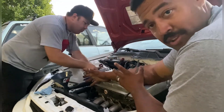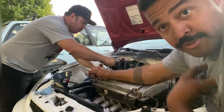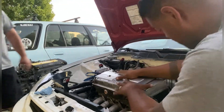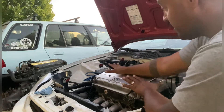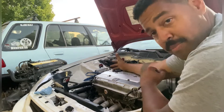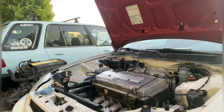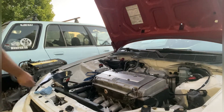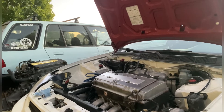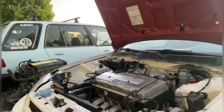I'm also very fortunate that when I went to prime the fuel system, my kill switch is a fuel cutoff switch — so when I flip that into the on position, my fuel pump starts on its own, separately from everything else. One of the things we didn't do was set the distributor. The timing should be good because it was good when it was taken out, so we just gotta set it here since this distributor came off the other motor. I'm gonna hop in there and try to fire this bad boy up.